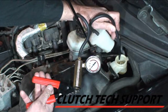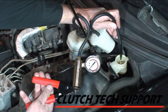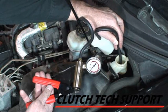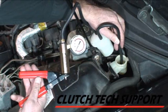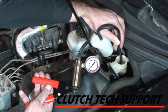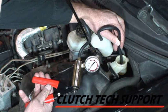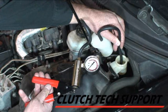Here's the vacuum bleeding setup that we used to bleed the Camaro. On the end of the hose, I put a little cone-shaped adapter that goes down into the port where the fluid goes into the master cylinder. I've got a catch bottle there, and I'm just going to apply vacuum to it — up maybe 15 inches of mercury or so — and then just let it sit there, and it pulls the bubbles out that are in the top of the system.